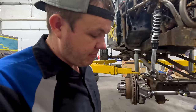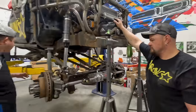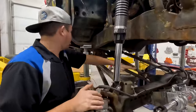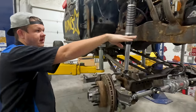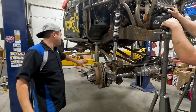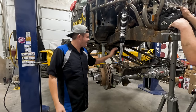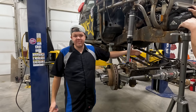All right, we're getting back to work on the Bronc Shining Star. What we need to do in order to get to King of Hammers is we've got to recombobulate these uppers. We're going to set the front of the Bronc turd on these, let it suspend, remove these arms, get them out of the way, do some super sketchy stuff — cut these arms off one at a time and recombobulate them at 20 degrees.